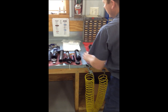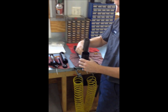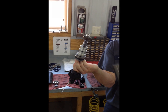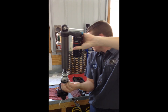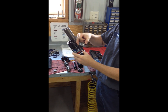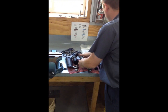Also these do have oil in them. Here's your body, and this is completely filled with oil. You have your valving just like a regular shock has, and nitrogen. That's what this reservoir is — you have a floating piston internally. I'm going to show in a little bit a cutaway that I drew out of how these work.